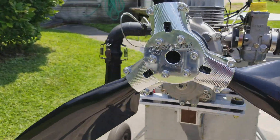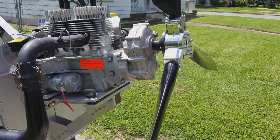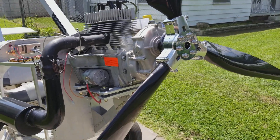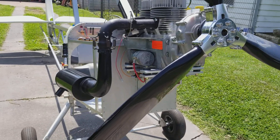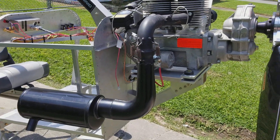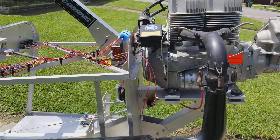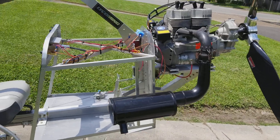The engine has never been fired — it has zero time on it, brand new. We haven't even put oil inside the gearbox yet, so that's one thing we have to do before our first startup. I have the propeller pitched at 14 degrees; the manual says that's a good starting point. I have a feeling my Affordiplane is going to be a little overpowered — it's a 53-horsepower Hirth engine, so climb-out shouldn't be a problem, and I really doubt we're going to be running full throttle unless we just want to really climb.